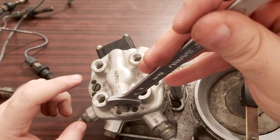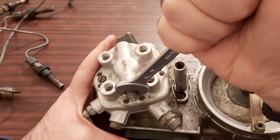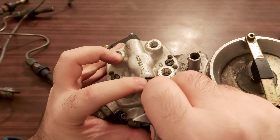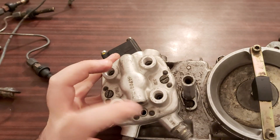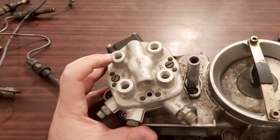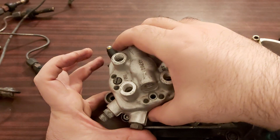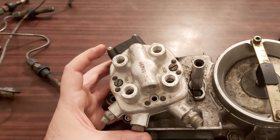As you can see, you have three screws — one here, one here, and one here. For the last one you will have to undo this fitting for the cold start valve in order to get access to it. The same way, as you undo those three screws, you just lift off the fuel distributor and that's it.